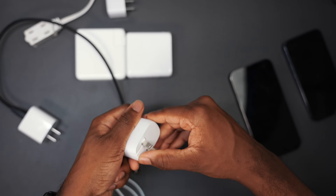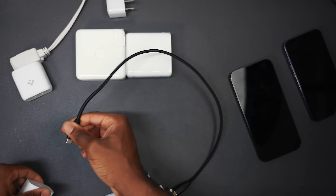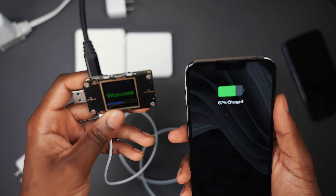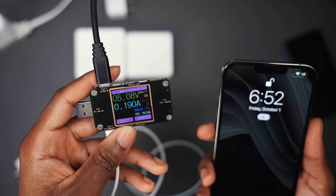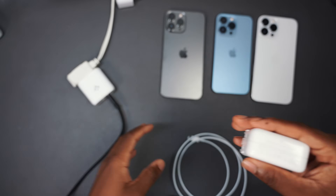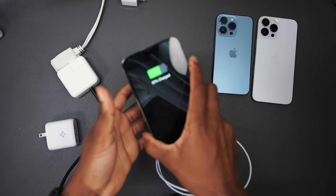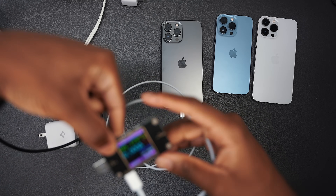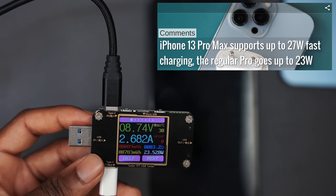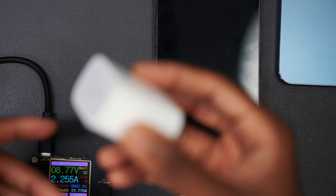This is a 30 watt power adapter, and I'm super excited because we could very well see higher than 20 watts charging on the Pro Max model. I want to see if that's a myth or reality. So the 30 watt power adapter from Spigen charging up the 13 Pro Max — let's see if we can exceed 20 watts. It's fluctuating between 16 and 17. Let me try an official 30 watt Type-C power adapter from Apple, included with the M1 MacBook Air. Let's see if we can exceed 27 watts. I'm reading an article that says the regular Pro can go up to 23 watts of fast charging. I cannot wait to do the full charge test to see if it's even worth buying a 30 watt adapter over the 20 watt.